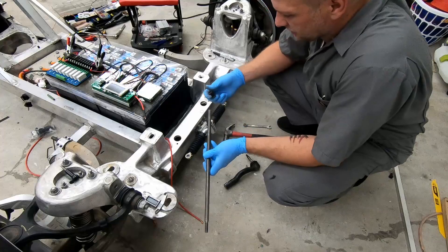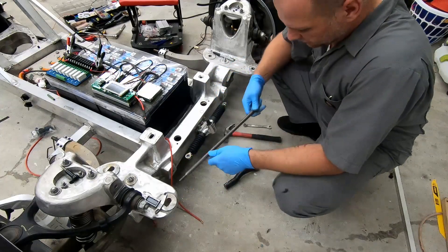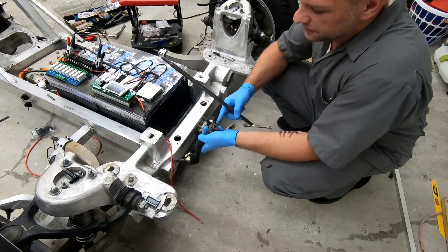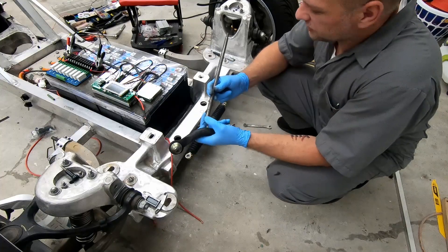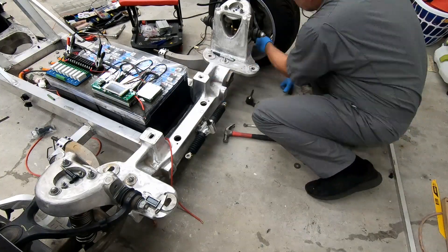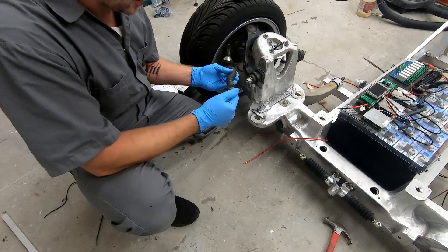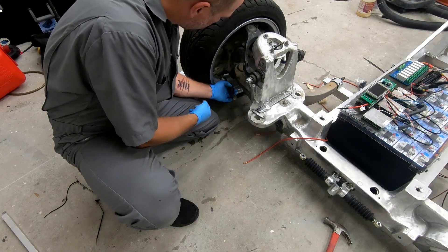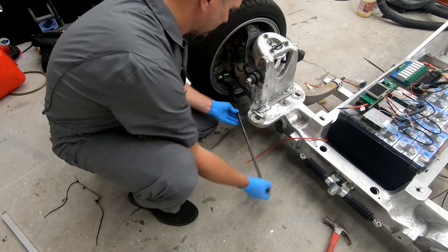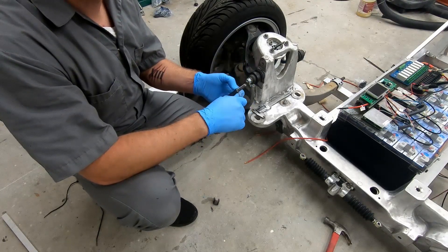So the kit comes with one of these, and you're supposed to cut it to length and then use these threads. But because we're going to reuse the Crown Victoria tie rod end, we'll go ahead and cut off the threading off the old steering rack, then weld it onto the end, and just use our flat part to attach our mounting bracket right here. So we have our tie rod end, we're going to cut off our threading — it's going to be sticking out of here — and the taper helps lock it in position on our control arm. Right now it's looking like we just have to cut off this part and weld on our threads from our steering bracket.